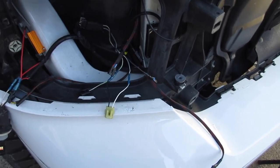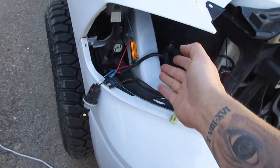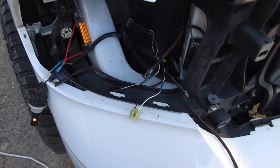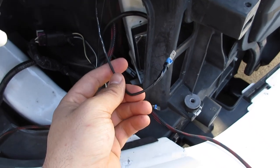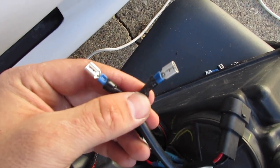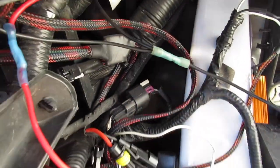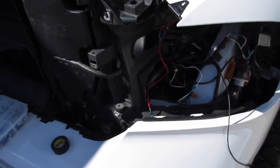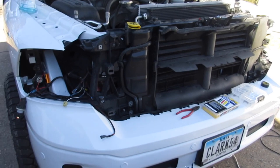Shortly after telling you I would just ground them to the metal, I realized — or remembered, I should say — that they are inside my headlight. So I can't just self-tap screw them to the frame or anything like that, because I would have to take that off every time I wanted to get my headlight off. So what I went ahead and did is the exact same thing I did with the positive wire — put it on a spade connector, and then I have the opposite end of the flag connector on the actual light itself, so they'll be able to plug in and unplug whenever I need to. Ran it across, split it, tied it in just like I did with the positive, and it is connected with the stock ground. Now I'm going to go ahead and plug these in, hook the battery back up, and ideally they should turn on with the toggle switch.